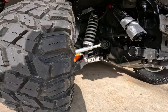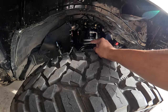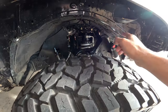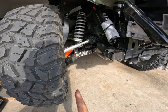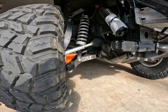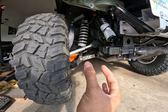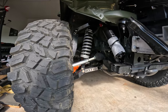This is the moment everyone's been waiting for — the front suspension. It's the Marlin Crawler RCLT kit. In the front I do have the Locked Off-Road suspension as well, with the resis. These are 2.5-inch, same as the rear, and I have it at the lowest setting until I get a front bumper on with some extra weight. With this kit you do need to purchase extended axles — these are the two and three-quarter inch extended axles from RCV, which are super cool. However, the boots are not sealed very well, so I'm going to have to redo those clamps and get them sealed up again.